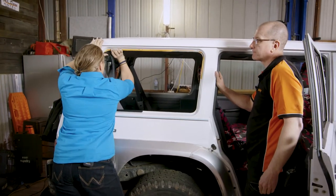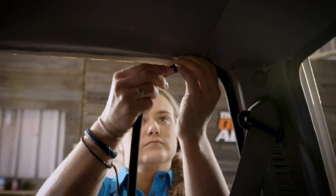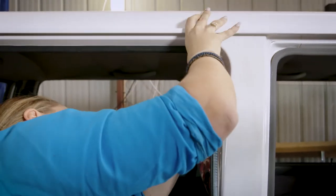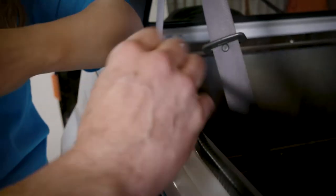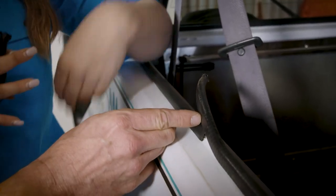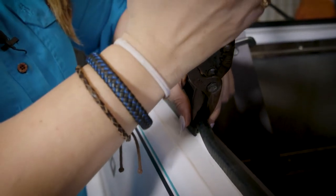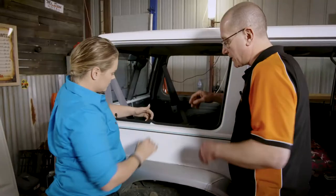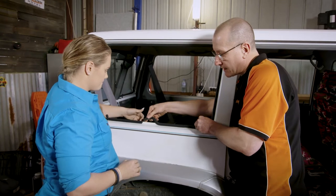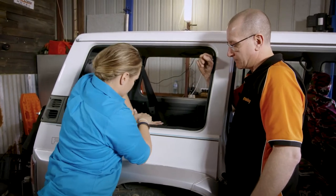What's the main importance for that? With the trim, it will rattle when going off-road — nothing more annoying, not that the trucks don't rattle anyway. So the next part is to cut this off. Just be careful because it's actually got metal casing inside it, and try to cut just over about eight to ten millimetres over. Just before you end there, we'll pull this up and come back and tuck the front in first — it'll give you a better seal.